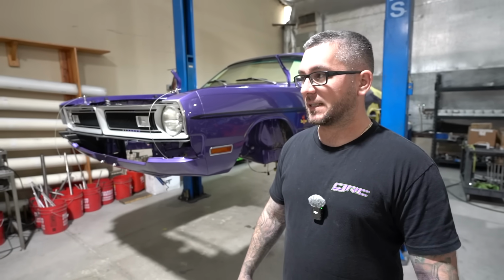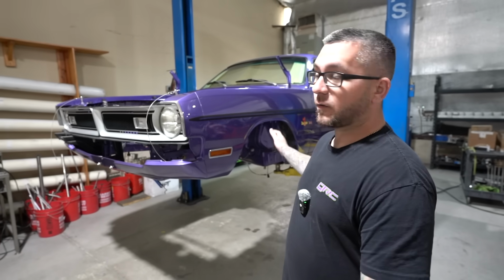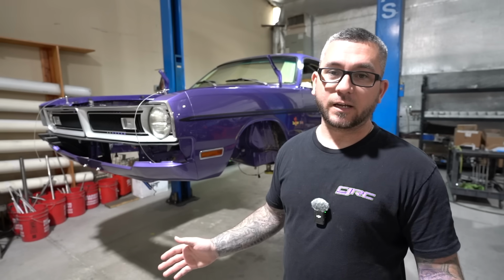He was going to have a street car. We had widened the stock wheels a little bit. It's going to be a more stock appearing deal than it is now. Basically what we're going to do now is cut the whole front off of this car. It's going to have a strut front end. All the stock floor and stock firewall are still going to be in it.